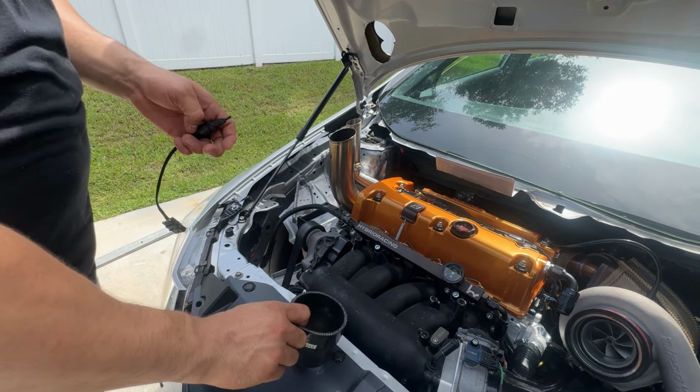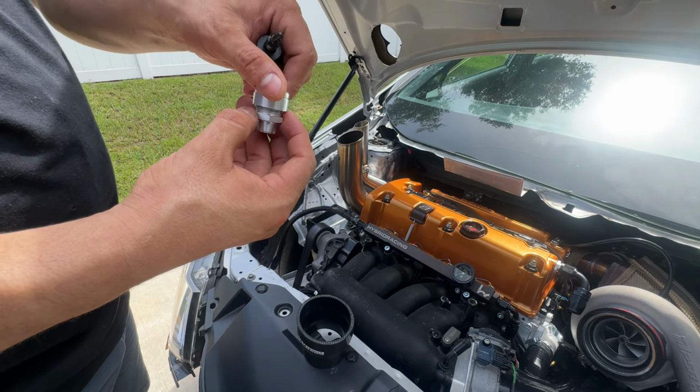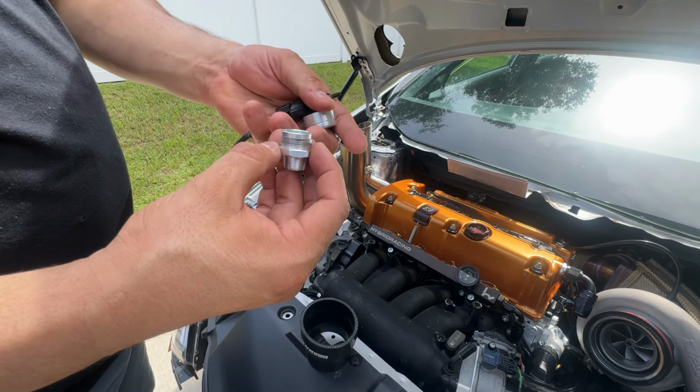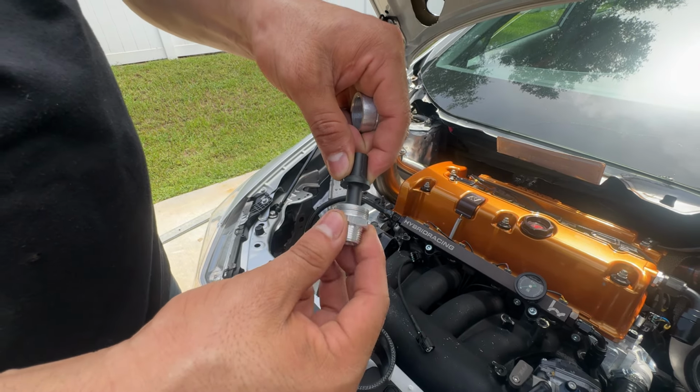And very simple, the way it works is a three-piece design, and I'm just going to quickly show you guys how it is. You can see here we've got the cap, the middle piece, and the bottom. Make sure there's an O-ring there, even for mine or the K-Tune one. Again, this is from an RSX. Now, in order to get this piece to work properly, you're going to have to shave down those fins right there. If you don't shave those, it is not going to go down. As you can see here, it touches that, okay? And that will be for mine or the K-Tune one, either or.